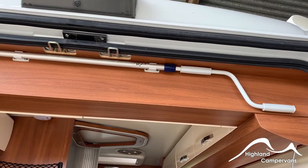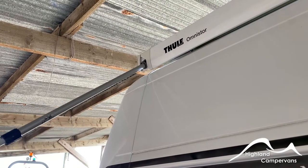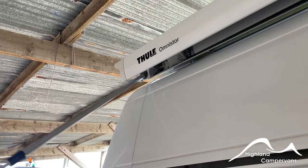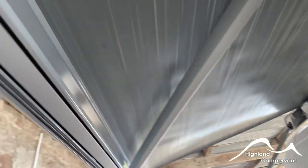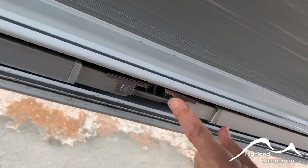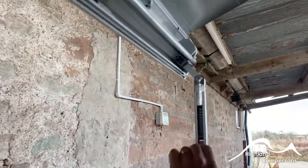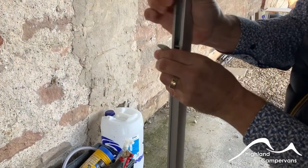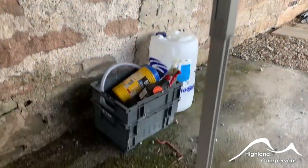The awning handle is stowed up above the inside of the double doors. Put the T up into the slot — these are sunshade, so in wet or windy conditions you have to put them away. T up in the slot, start to twist and the awning will begin to roll out. You've got legs which are clipped up into the pelmet — simply spring-loaded. Bring each leg down, let the plastic lever drop through your fingers onto the floor and then lock that lever back. They are quite stiff — just at the point you think that you're going to break them, they'll lock into position. Same on the other end.